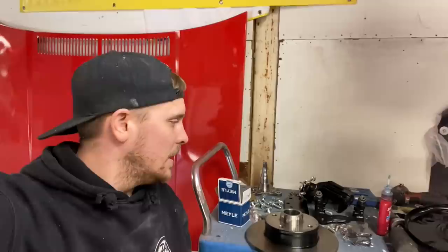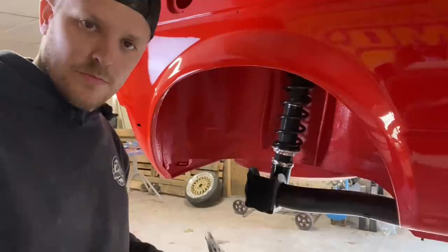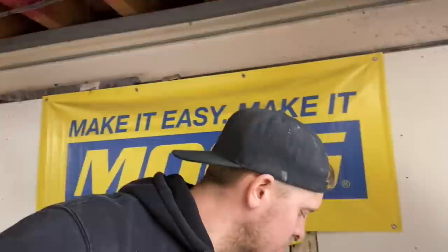Now, something that I'm going to be fitting to this car that you might not fit to yours is this here, which is basically a drop plate for the rear axle. Normally, the stub axle would bolt directly onto the hub, or onto the rear arm, sorry. But what we're going to be doing is using this rear location plate, drop plate,